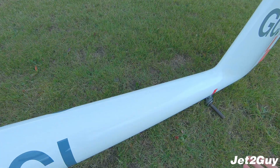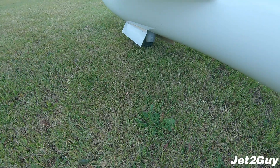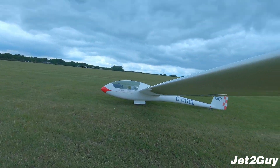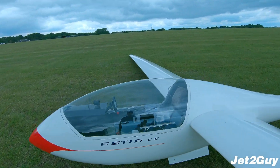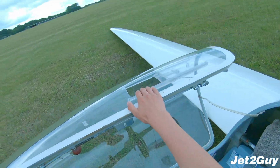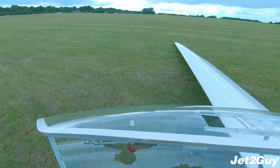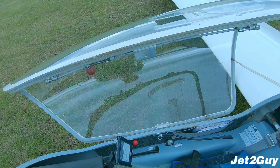I also look at the tail as well — there's been a hard landing recently so I want to check there's no damage, and there is none. I also check the wheel from behind and everything looks good there. After the exterior check, I do a positives check, which basically ensures the glider has been rigged correctly. For example, when I push the aileron to the right, I expect the right aileron to go up and the left aileron to go down. You do that for all the control surfaces and that's fine.